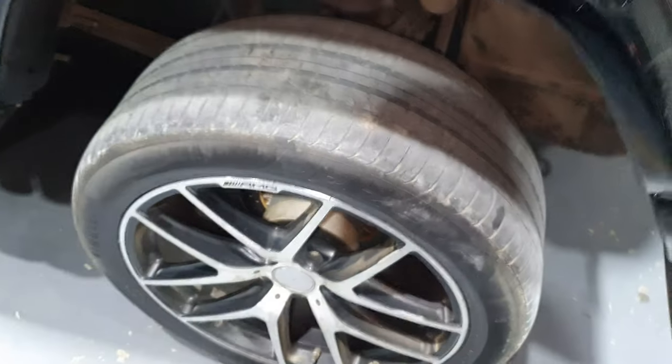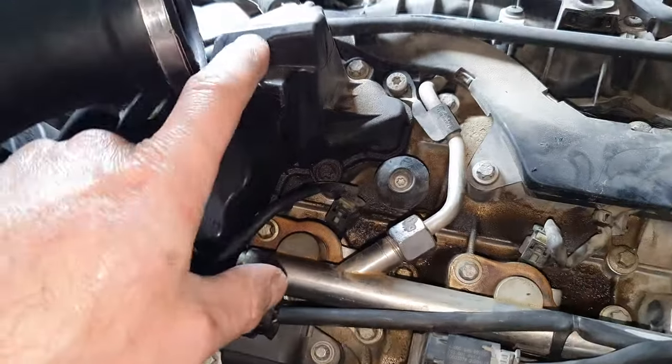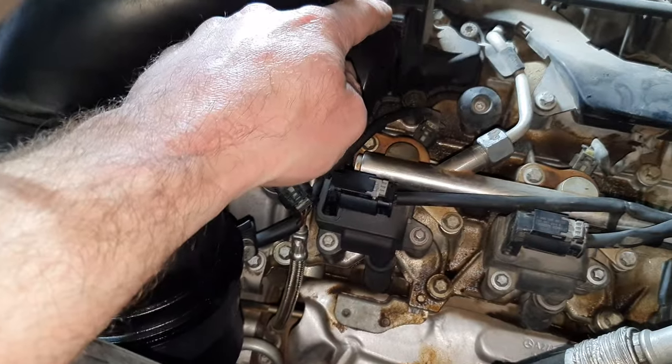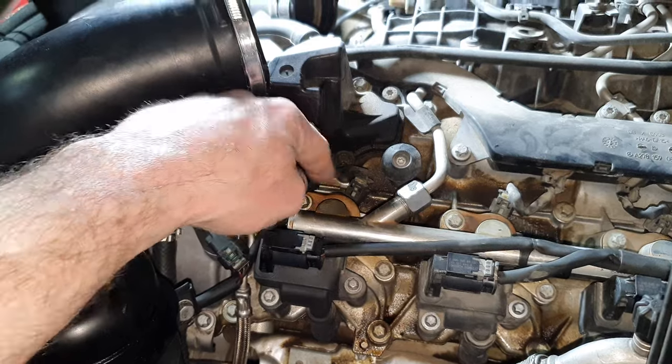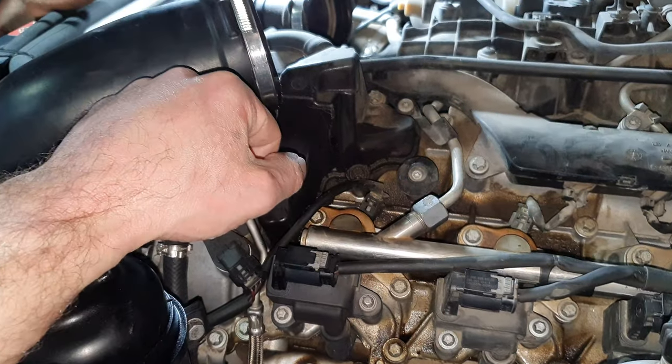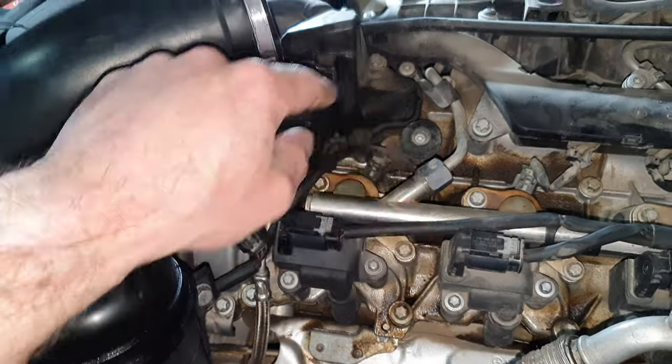Hey, let's see the front right. Yeah, you open it? Yes. Nice. Where is it? Ah, it's leaking from the breather here. All right, nice. That's an easy fix. These four bolts only. Yeah, I need the seal for the breather. Here, that's why it comes wet, you see? It starts from there, it's not from the cover, it's from the breather.